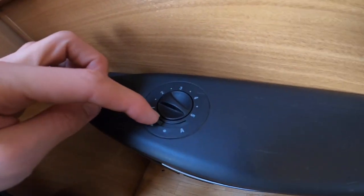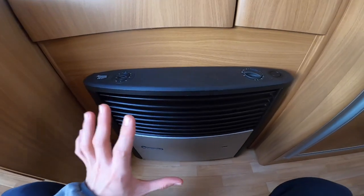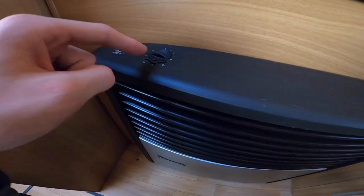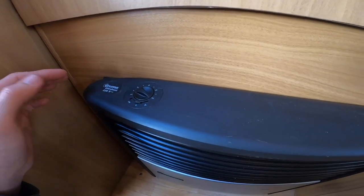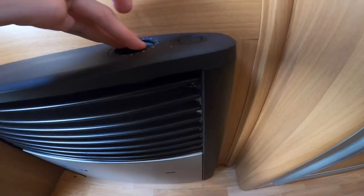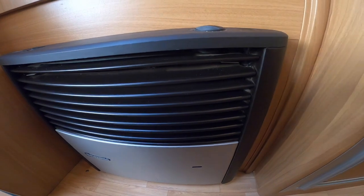So normally you would have a convector out the front of the fire if you're wild camping, and it'll save the 12 volt assisted fan because it'll not be taking a 12 volt feed from the leisure battery and wasting any power. And then you can have it on A or M when on site, and this will distribute the heat around the vehicle. But remember, hold this in as it will keep the thermocouple open and the gas will filter through on your gas fire.